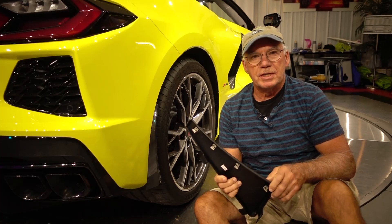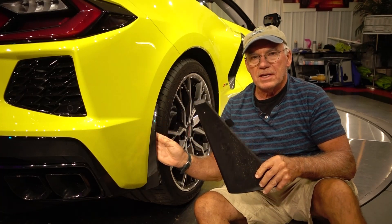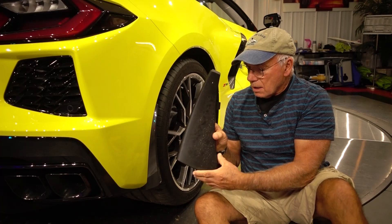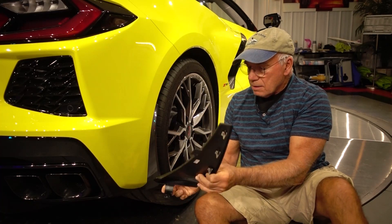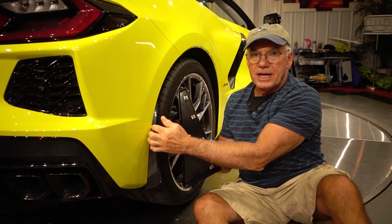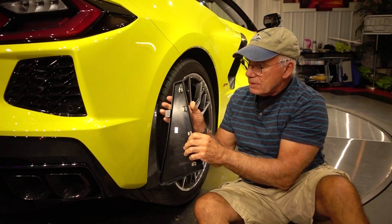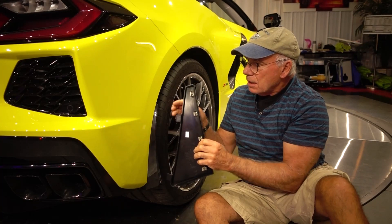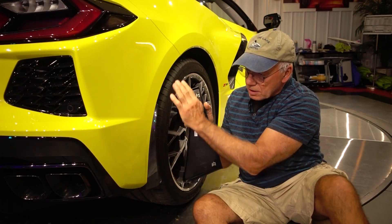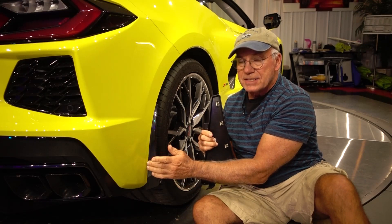So if there's one piece that you should replace on your car, it's these so-called rock guards — splash guards — when they go inside the wheel well. They're in with just one screw in the bottom down low. Take that out and there are like four snaps where you can reach in and pop it with your fingers. If they're too tough, take a little plastic tool and pry it out. These things sit even with the body line of the wheel well, so it doesn't offer any protection.